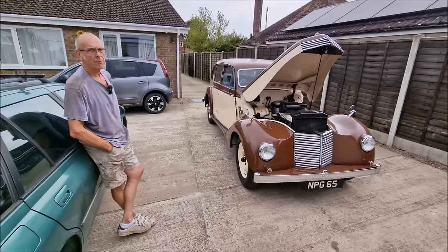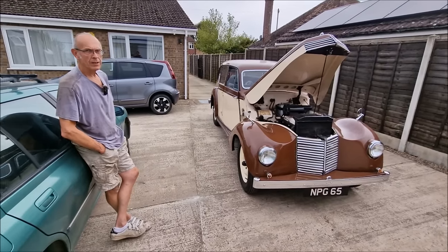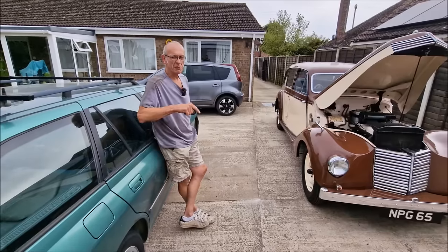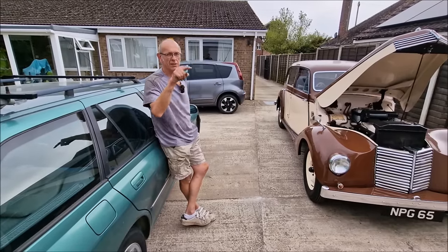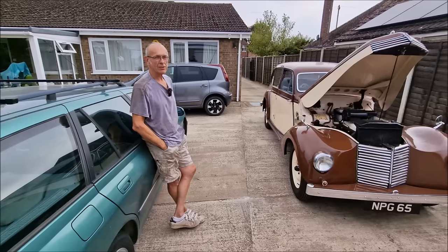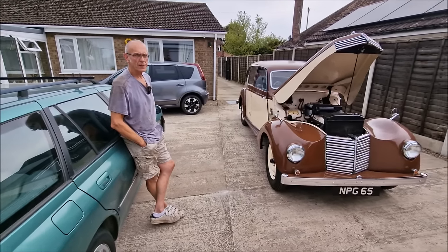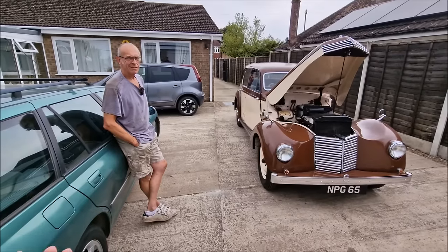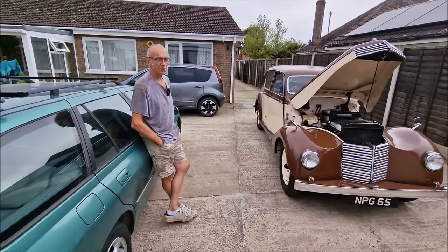Yeah, and then I'm guessing you've done the welding. I have, mate. Talk us through the welding process then. Grind the crack out, weld up, and I made a strengthening plate, so now it's got a strengthening plate underneath it. So it's now stronger than what it was. Did you take the piece off the actual chassis? No. Did it in situ.